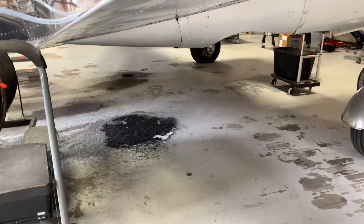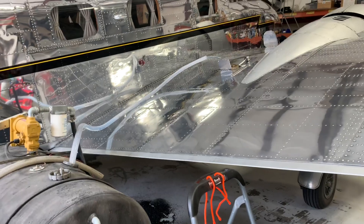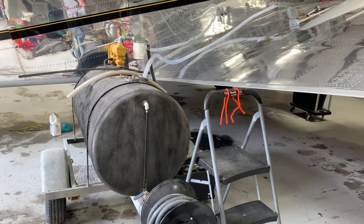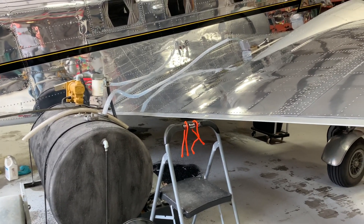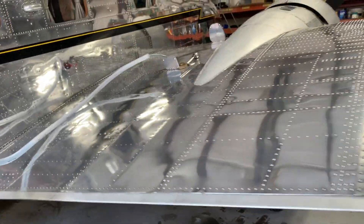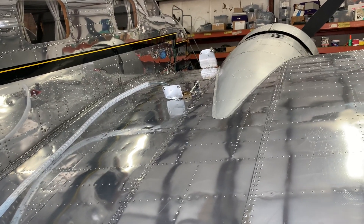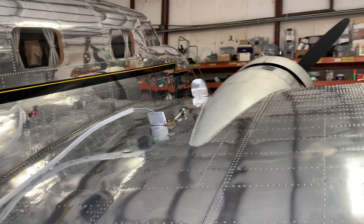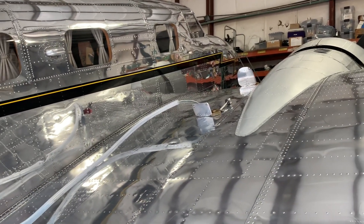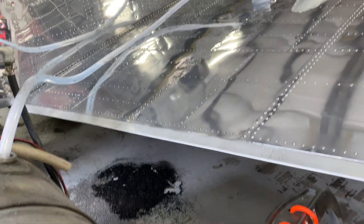My entire front tanks appear to have been draining into my rear tanks. I've had to rig up a drain here to drain it all. Luckily I've got a hundred-gallon tank to drain into, but I'm having to drain the rear tanks so that the front tanks can drain into the back tanks. What's been happening all night is the front tank has been draining into a full back tank — it didn't have anywhere to go and just spilled over onto the floor. I've got about half a tank of gas out of the front of both sides draining into the rear tanks all night, and I came in to a completely wet 100LL floor.